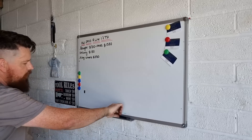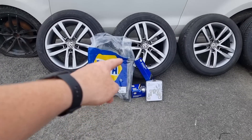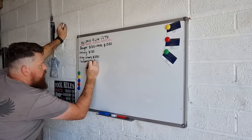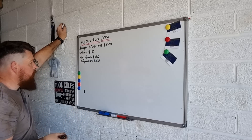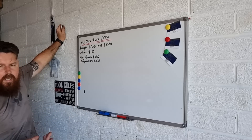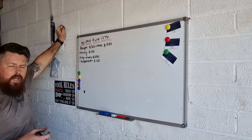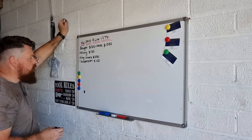So where are we with this build so far? I've written everything down that we've done and spent. All the suspension components — the outer track rod, tie rod, and lower arm — were all brand new parts and came to £100, which is a lot, but they are more or less genuine parts. I didn't want to buy second-hand suspension parts because at the end of the day you've got rubber bushes and ball joints on them, and you're just buying something that potentially won't last. I wanted something done properly that's going to last a good while.